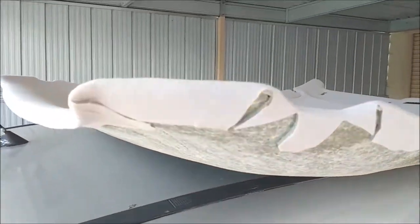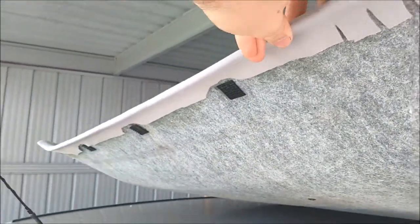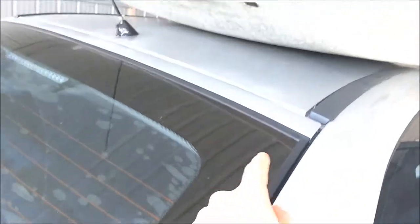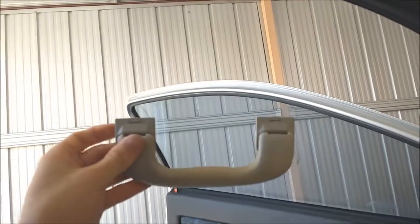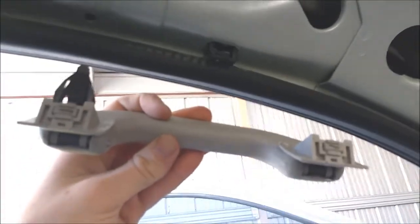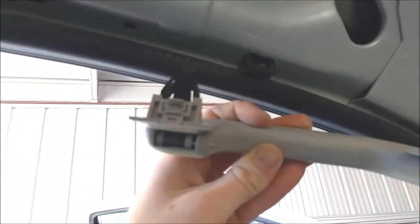Actually, while I'm at it I'll do the whole thing - more information in the world is better. The easiest part of the whole thing is getting the back out, which is just held on by three little squares of velcro and sits just across here in the back of the roof. Next thing to take out is grab handles which come from up here. There is one clip still in the car and one clip I've pulled out just for this demo so you can see how it goes together. You pull it out like this, then when you're putting it in I suggest you reassemble it like this because it makes life much easier to just push the whole thing back in - like they did at the factory.